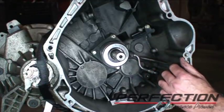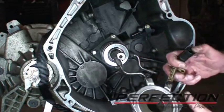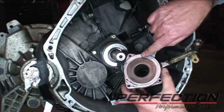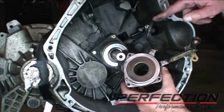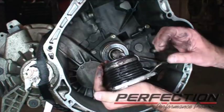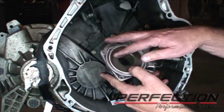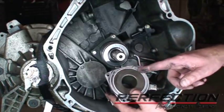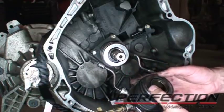Make sure that the holes inside the transmission case are good and clean, then apply the three-step tightening process. This is a two-piece system — the steel inner sleeve is attached to the aluminum casting with a little crimp, but that crimp isn't strong enough to hold it under pressure until it's bolted up on the front of the transmission case. So one thing we don't recommend is taking the slave cylinder in your hands and compressing it to feel it or compress the preload spring, because that back plate is only held in place by the crimp until it's mounted. Resist the temptation to squeeze the slave cylinder. Get it mounted, get it installed, get it bled.